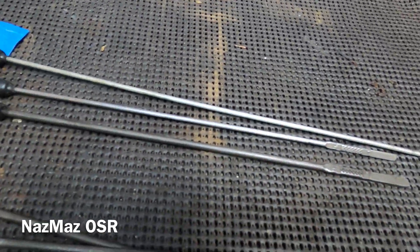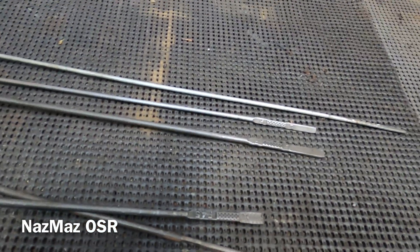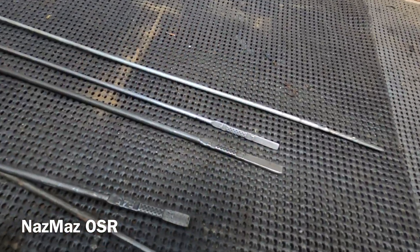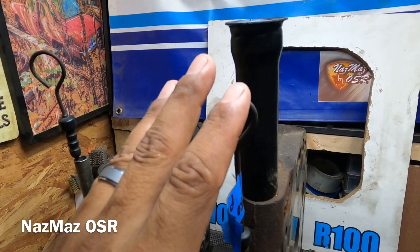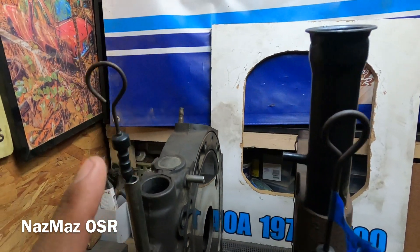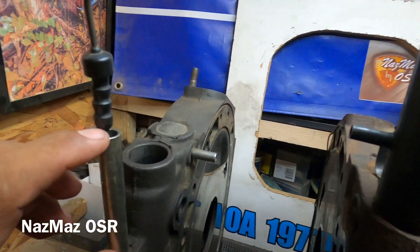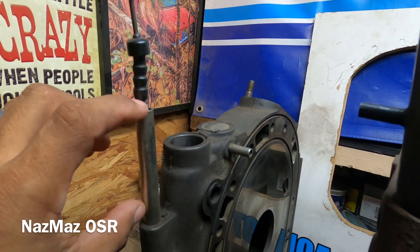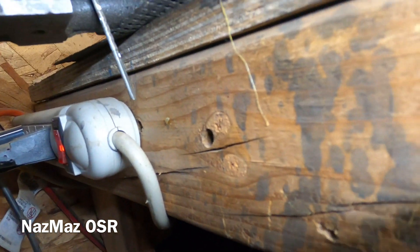This one is from an FC 13B - huge difference. I've had a couple of cases where they used an old school 13B dipstick on the FC - that's a big no-no. You'd have oil leaking out everywhere. So these are two 13Bs: this is from an FC - 1986 and up - and this is from the old school 13B, 1974 to 1976. You can see one is sitting higher than the other, because this one has a sleeve right here, which makes the dipstick a bit longer. This one doesn't have a sleeve, but this one does.